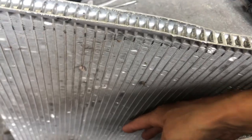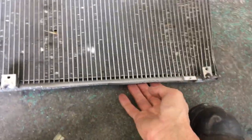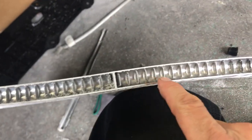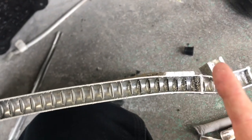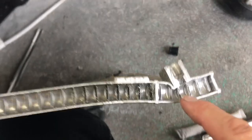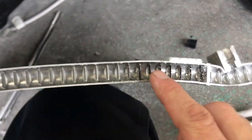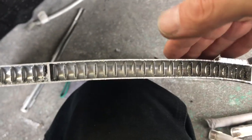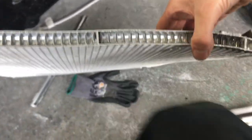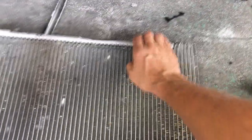Now we're taking a second pass back in the other direction. We go back to the other side and come back here. The refrigerant is forced all the way down here, but what do we have again? A block right here. This is the sub-cooling section — one, two, three, four, five, six. So now this is going to go back down where it's open, and the refrigerant is forced back in again. We're making another pass, and the refrigerant is flowing in this direction.